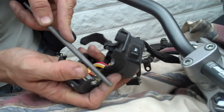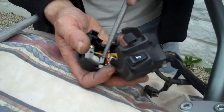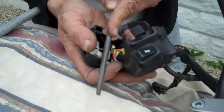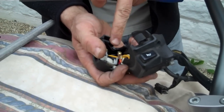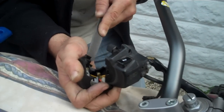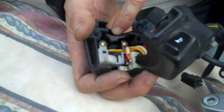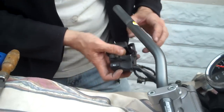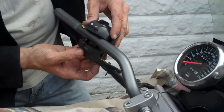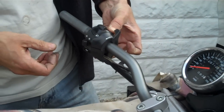Just take a half-round file, open it up, don't stress the wires too much. Put your finger the other end to steady it, and without rubbing anything else, just file on the face of that little button. It takes about five minutes — as you can see it's already going through. There it is — pretty much filed out, nice and easy. Just leave a tiny bit of it there to grip. It pops back on the bar and when you do that up it will bite nicely. No holes drilled in anything.